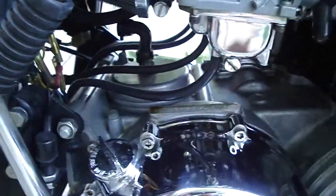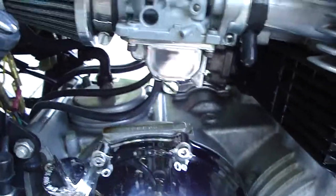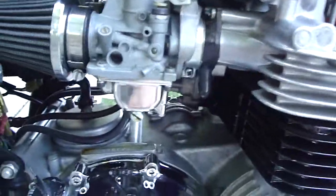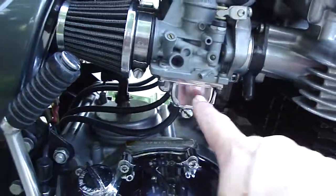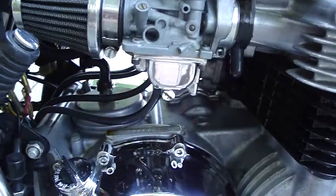You've been out riding and you're on your way home and you're nearly there. What I've done to minimize the fuel mess is I turn the fuel off 2-3 blocks away from home and ride home with the fuel off, so that way you partially drain the bowls, you get the level down, so you're not weeping so bad, and it makes a big difference.